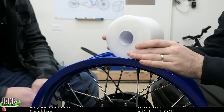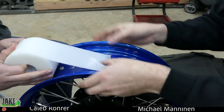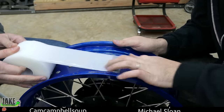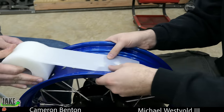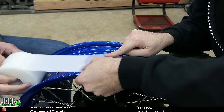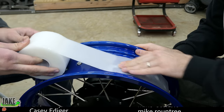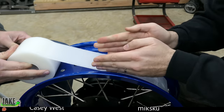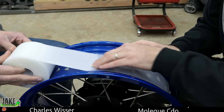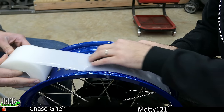This is the magic — the 3M Extreme Super Sealing tape. We've gone with the widest strip you can get. Ian's job is to keep tension so we don't get any wavy stuff, and my job is to come down and when we get to a nipple, you don't just mash it — you kind of go around it. This one's super easy because of how wide the rim is and how wide the tape is. There's a lot of clearance beside the nipples, so we have a lot of surface area. Don't let it crease anywhere — absolutely cannot crease. That's something I've seen where people fail doing this — there are just creases in the tape and that's never gonna work.